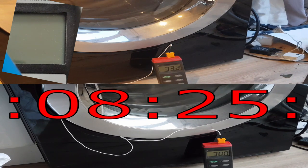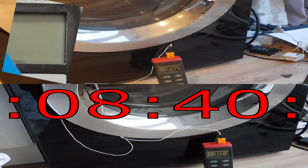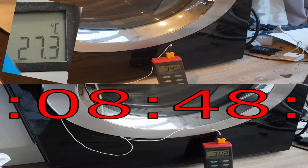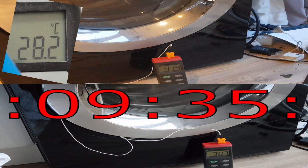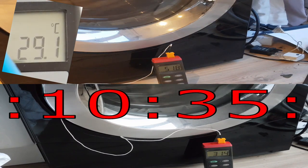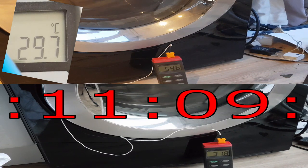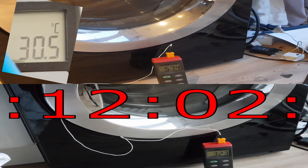You want to see a 10-degree increase from whatever temperature it was when you first put the probe in. I don't think a heat pump dryer should be used in a room below 15 degrees - it just wouldn't work. Now if the compressor still works but there's no gas in the system, you'll still see a temperature increase because the heat from the compressor gets blown into the drum, but you'll probably only see a four, five, or six degree increase. Fast-forwarding to 11 minutes: 18 to 29 - an 11-degree increase on the Beco, and a 10.5-degree increase on the LG.